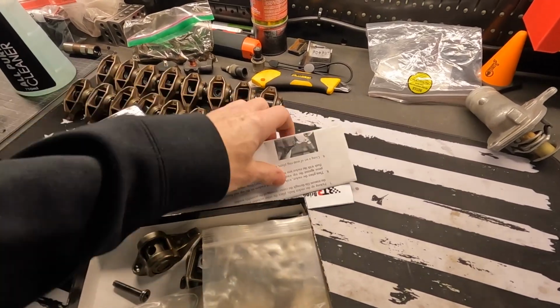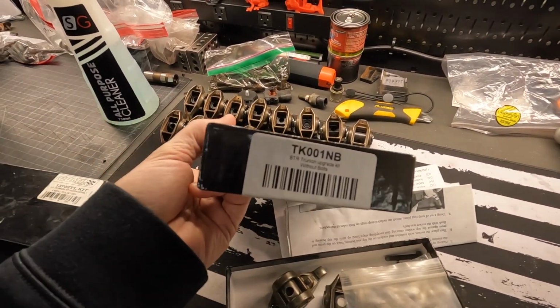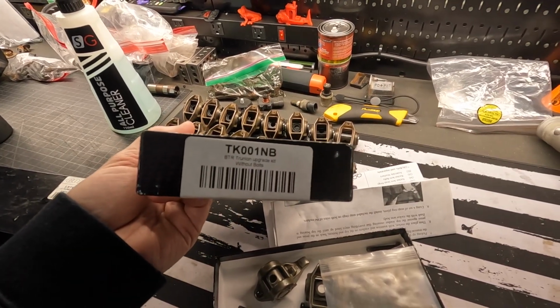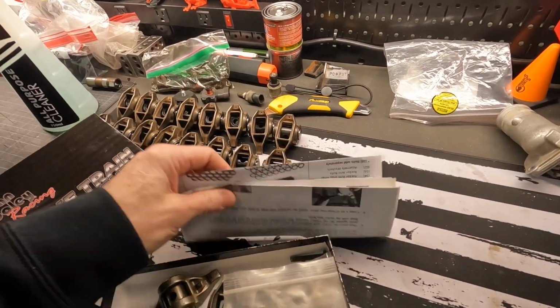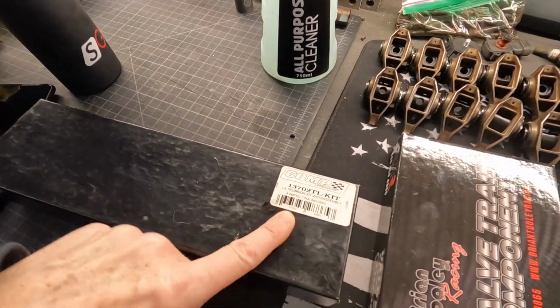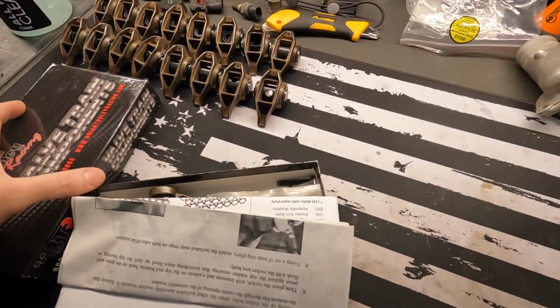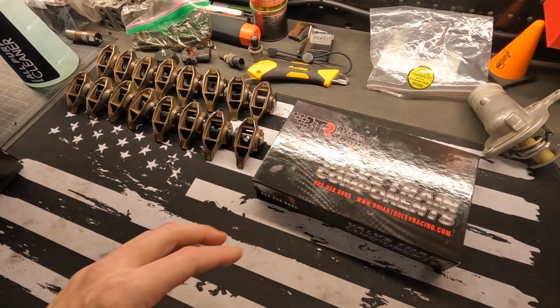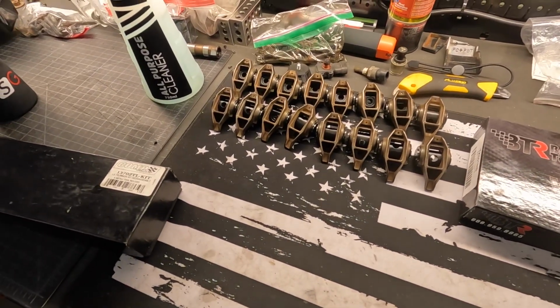Again, this was a Brian Tooley part, TK001NB. That's the trunnion upgrade. I also have a Comp Cams trunnion install tool, but Brian Tooley sells one as well. This isn't sponsored or anything, but they are kind of a local company to me, so I really like their products.